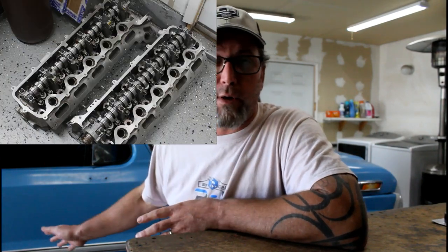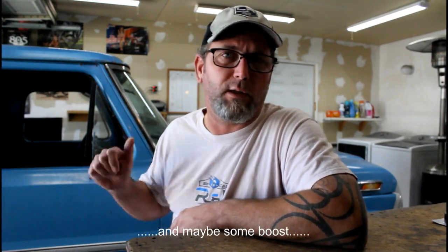I think this motor has a lot of tuning potential. Unleashing 50 or more horsepower is going to be pretty easy just in the two-valve configuration the motor is in now. I do have some three-valve heads and cams for this — I've got a three-valve timing cover — and I'm putting together all the other little parts and pieces I need for the three-valve swap. Once the kinks are worked out and it's driving reliably, the next major step on the motor is the three-valve swap. Bolting on those three-valve heads should get me another 50 to 60 horsepower pretty easily, and the intake manifold is a much more free-flowing, high-RPM type of intake.